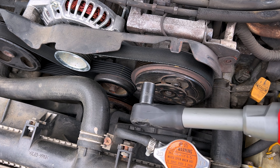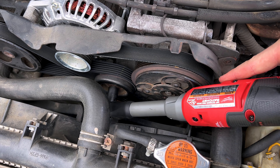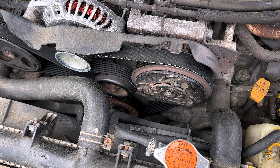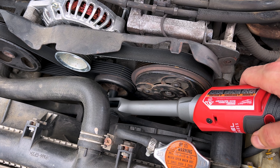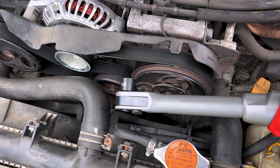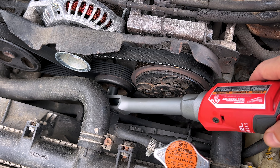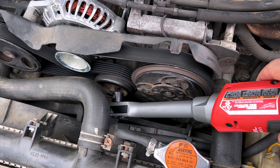Here's a quick real-world example of that space savings in action. We're on a 2002 LL Bean Outback with a 3-liter. If we wanted to get to this idler pulley — we can get on it, but we are very close to that cooling fan. Once we start taking that bolt loose, we're going to get jammed up against the fan and have to finagle the ratchet around. Compare that to the access with the Insider ratchet — we've got all the room in the world to back that fastener out. We're just showing the space savings of the Insider assembly versus a traditional shallow socket on a battery ratchet, saving you from switching back and forth between hand tools and power tools.